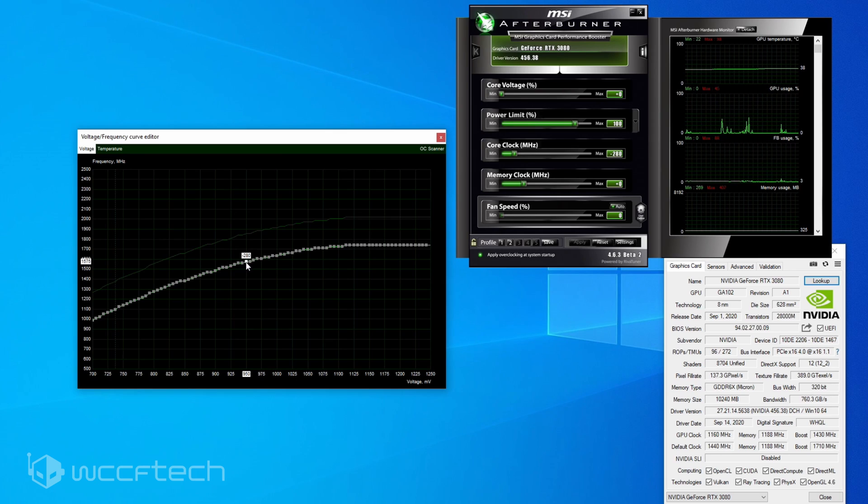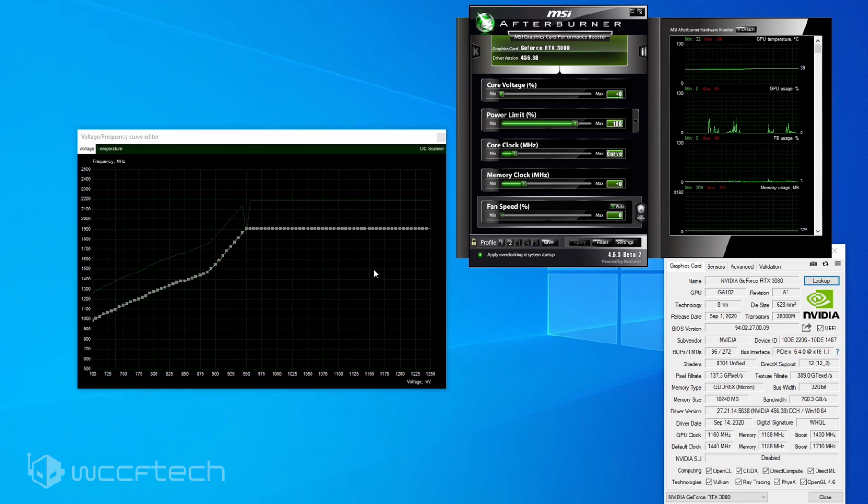From that starting point, drag the dot so it's above the baseline — otherwise it's just going to be a step. You want to adjust the entire line to the right of where we're at. To get back up to stock frequencies, drag it back up and target around 1900 megahertz. Hit Apply, and that's going to adjust the whole curve from that point — it won't try to raise it past this point. Your boosting algorithms will still work, but this is the most you can target.